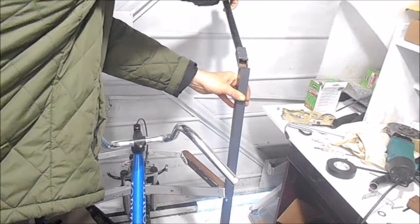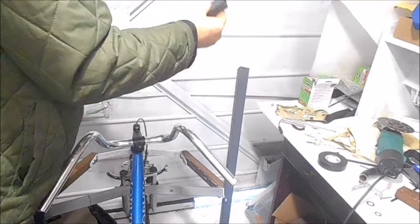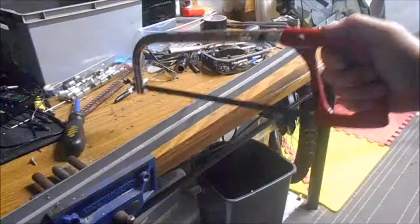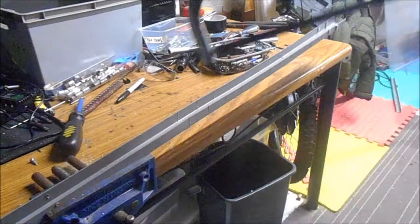I'm just bending that off now. Sometimes it's easier to score metal and then just bend it off rather than sit there with a grinder for an hour trying to cut it. We've chamfered it at an angle because we're hopefully going to be getting some roof bars. I found some soft aluminium metal, and what I'm going to do is hacksaw it at one-and-a-half to two inch sections nearly through — this will allow me to bend and twist it.